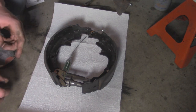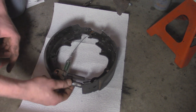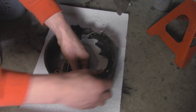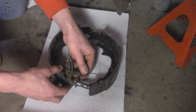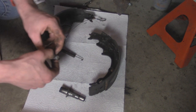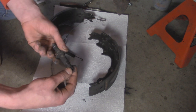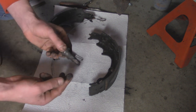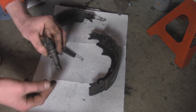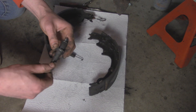Focusing back onto our shoe assembly - I'm going to take off the self adjuster down here. This is the star gear and it's supposed to move back and forth like this, so it's probably fine, but I'm going to add a little bit of grease so it doesn't seize up in the future. There's not a whole lot of threads sticking out so this thing wasn't really expanding that much - it wasn't really self-adjusting. So I'm going to take it out, clean off all the threads, put some brake grease in there, and then it should be ready to go back in.